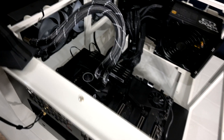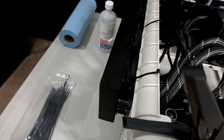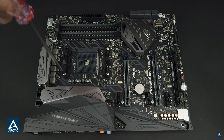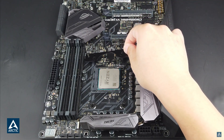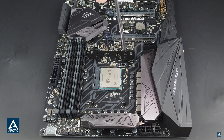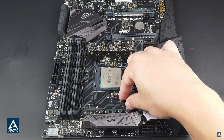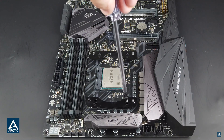As for installation, I'd say this was the only thing I hated about this cooler. I don't have first hand experience with the previous revisions, and I had heard that those were terrible and Arctic had made some improvements, but even so I feel like they've got a long way to go. First, you have to take off the plastic tabs which come pre-installed on AM4 motherboards, then you have to place these 4 black plastic spacers or standoffs, which then allow you to install two mounting clips onto the motherboard that are screwed into the backplate. I would highly suggest doing this part outside of the case on a flat surface — it will make your life much easier, as doing this when the motherboard is installed inside a case makes it tricky because there isn't really anything there to hold the socket's backplate.